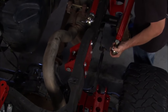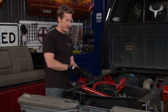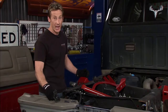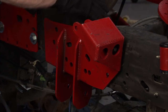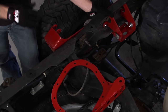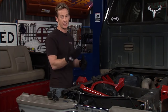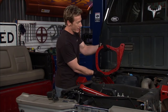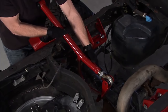We had this stop in place to activate the overload spring. Since we're not using springs anymore, this gets pitched to the side. We're still going to use the same mounting locations for our new bracket, which will relocate our shock to the outside of the frame and mount our track bar. The track bar will keep the rear-end housing from moving side to side. Since this truck didn't have a four-link system before, we need to mount the track bar bracket on the other side at the differential.